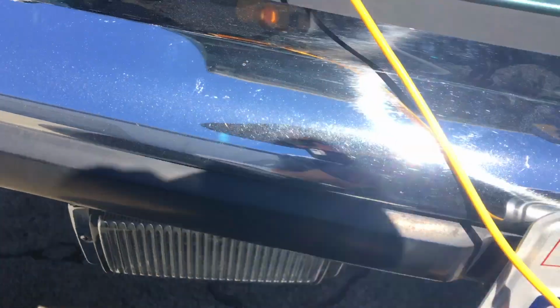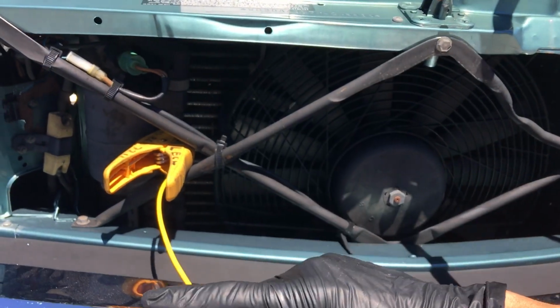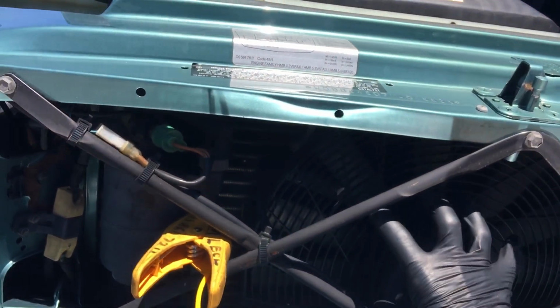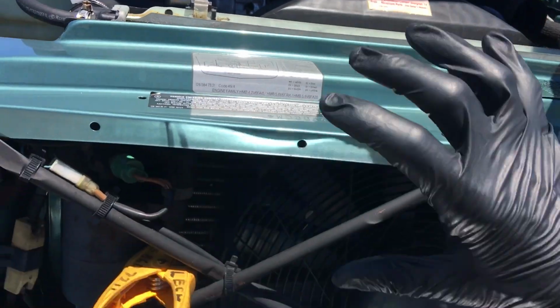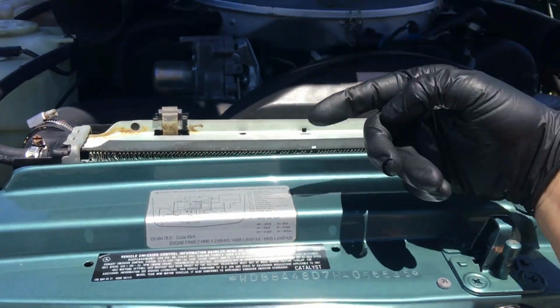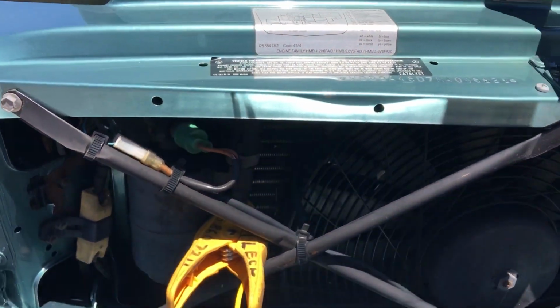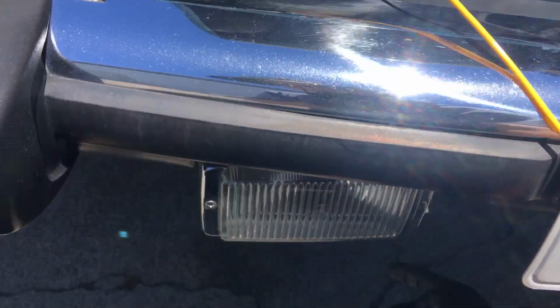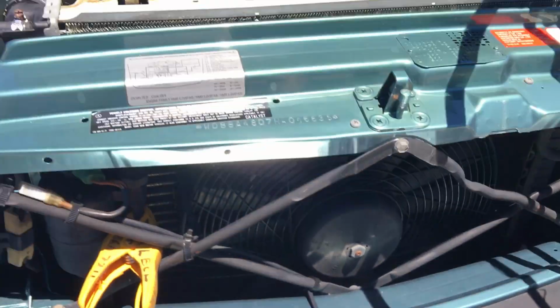And if I put my hand down below, I could feel engine air pull forward and come back and come to this negative pressure area because the mechanical thermal fan clutch is drawing air from it. So this is a low pressure zone, this is a high pressure zone. So if you were to actually have like a theatrical fog, you would see this little roll of air coming around, a little roll of air coming up and feeding in front of the condenser some hot air.